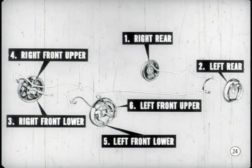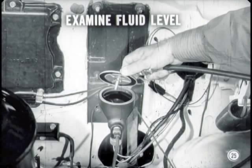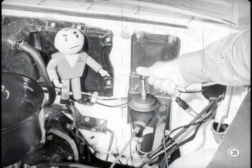30 seconds — I get it. Is there any order in bleeding the other cylinders? You follow the right rear with the left rear, then the right front lower, right front upper, left front lower, and finally the left front upper cylinder. When you finish, remove the adapter and bleeder tank. Be sure the brake fluid is at the proper level. Don't tighten the cover too tight either — that could bend the cover and then it could trap water that might leak into the fluid.